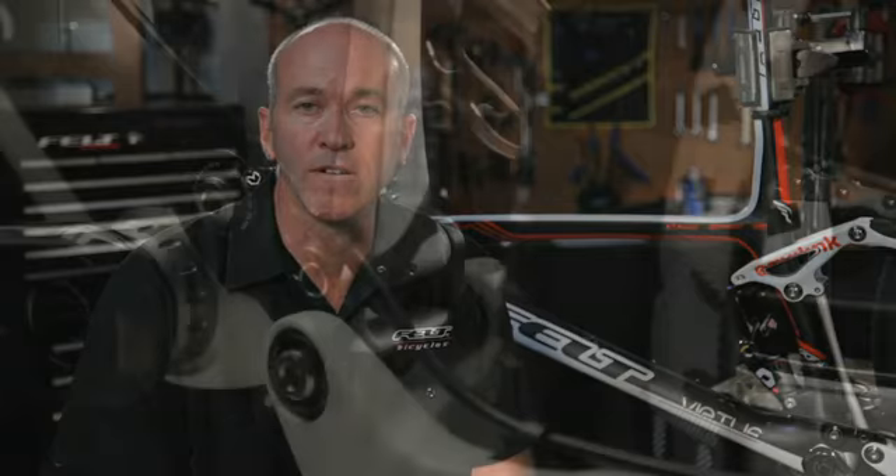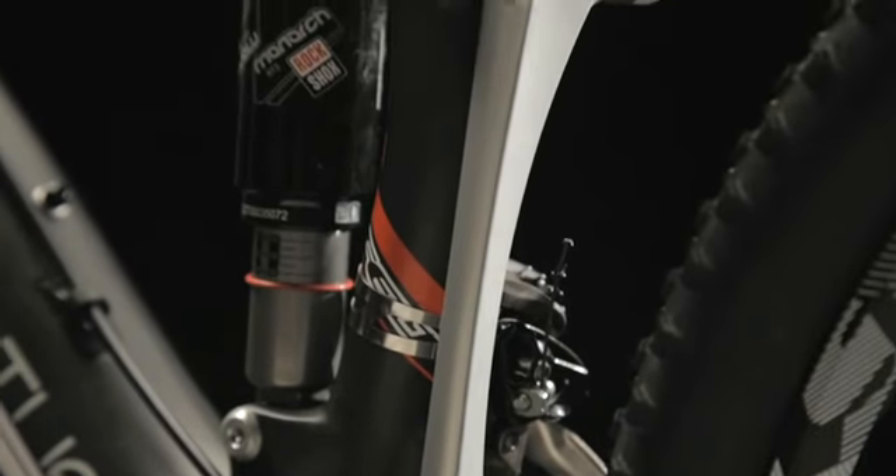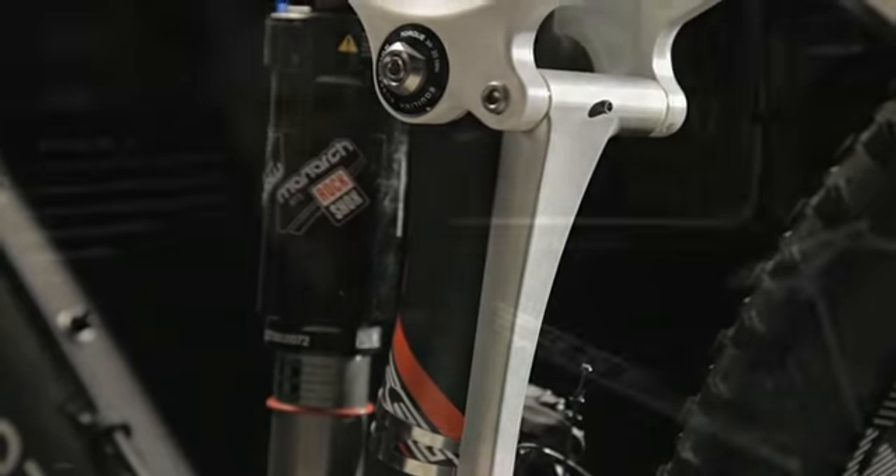We have a front triangle carbon Virtue and a full carbon Virtue. We have lightweight stainless steel axles in the Equalink that use DU bearings. DU bearings are small Teflon-coated moly disulfide bearings that are very lightweight and very easy to service. They're the same type of bearings that you find in the tops and bottoms of shock absorbers. By introducing these things, we were able to take a lot of weight out of the chassis.